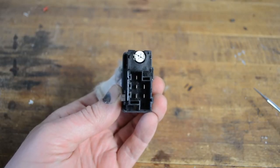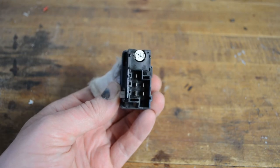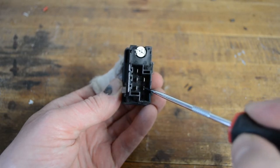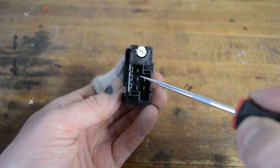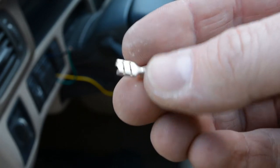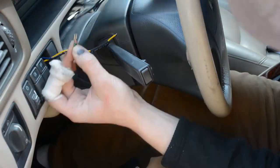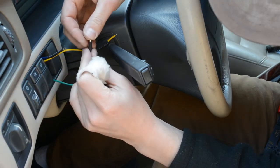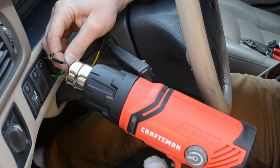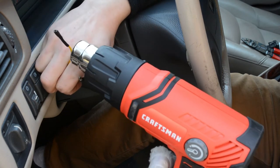Here's the back of the fog light switch — the terminals are numbered 1, 2, 3, 4, 5, and 6 is blank. The way it gets wired up: terminal 3 is your signal, terminal 5 is your ground, and terminal 4 is your power. So if you're using the Hella wiring it would be yellow, blue, and green respectively. The wiring kit includes terminals that coincidentally fit the Volvo switch as well, so you can just use those no matter which switch you're wiring up. If you're using the Volvo switch, be aware the terminals are close together and may touch vertically, so heat shrink right down to the end of each terminal to prevent contact between wires.